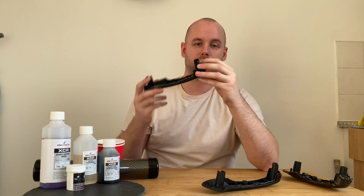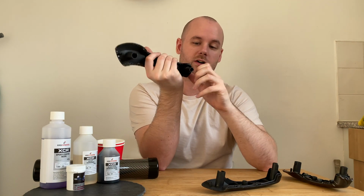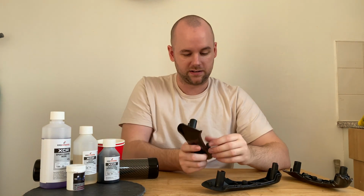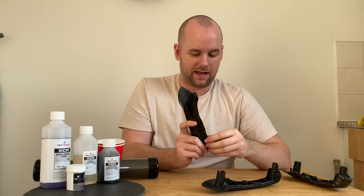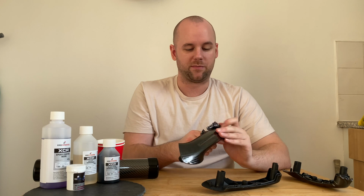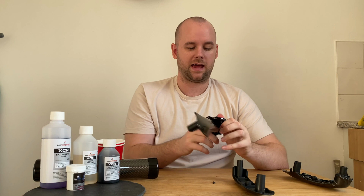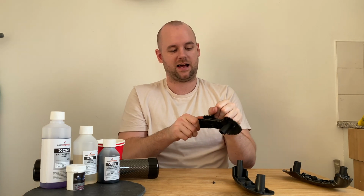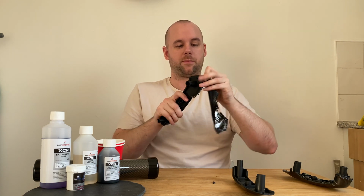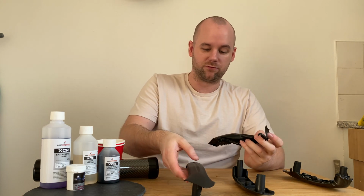So the first thing that we need to do is sand all the original plastic bits down. One of the big things after speaking to people is the prep work, so making sure that these are very, very well sanded, so they're very rough, as well as using a Stanley knife just on the edges, because the first stage is to mix an adhesive which the carbon fibre sticks to, and for that to stick properly to something like plastic, they need to be really, really rough.